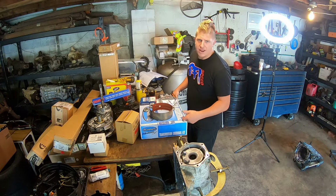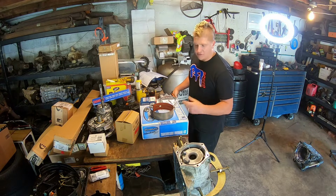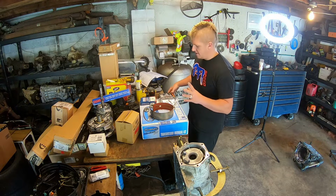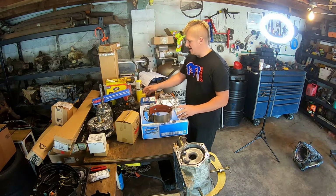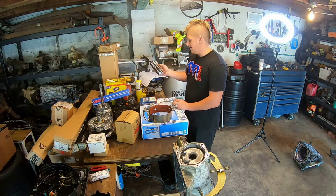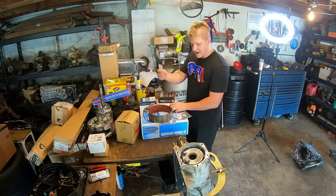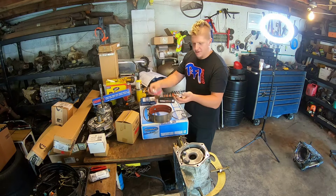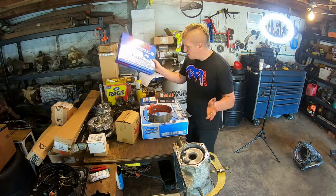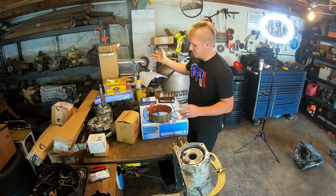It came with a 29 element sprag, a few other little upgraded parts as well, a Corvette servo, and so forth. An extra wide band, a boost valve kit, a valve body shifting kit, some seals, Delrin check balls, aluminum servo and accumulator pistons, a Transgo shift kit, and I even treated myself to a couple new tools.